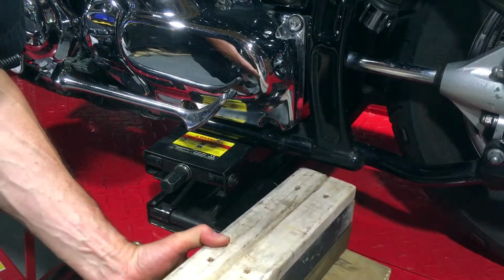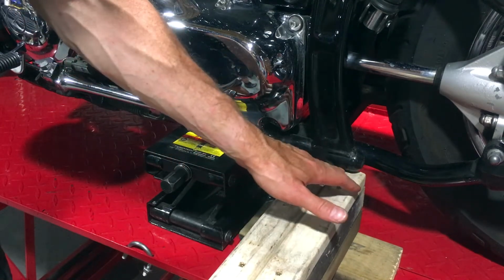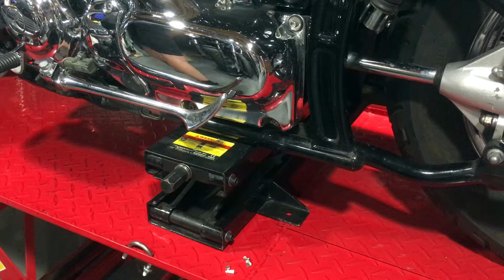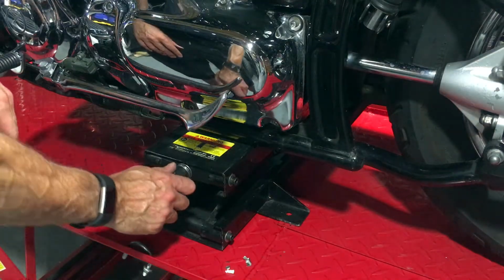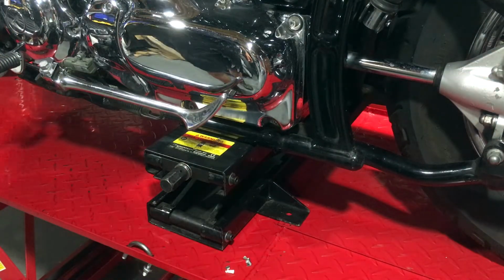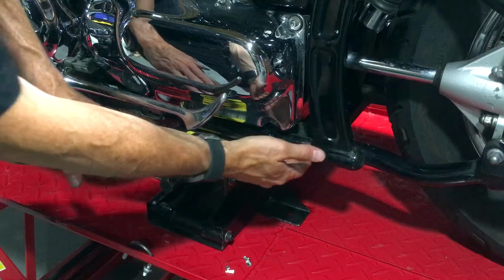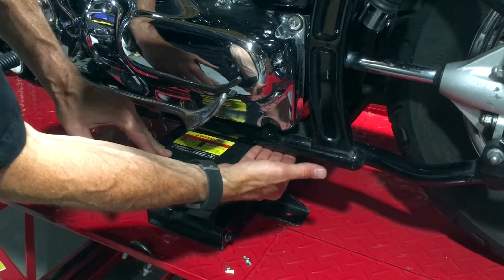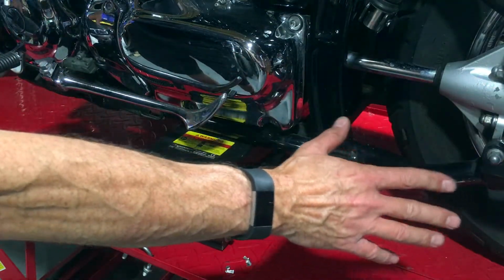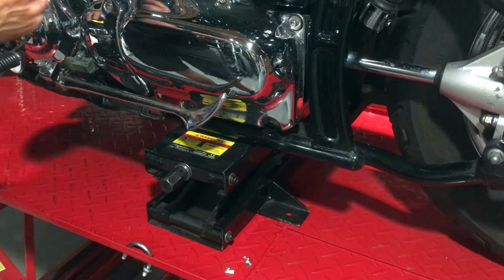Now, this doesn't form a tight fit under these rails. There's a little bit of wobble room, but I can shim it with pieces of plywood so that it does actually sit level. But a table jack does the same job. Again, it's a little bit of an investment, but they are really useful. And you just wind it up. This one's just hand tight because the bike is currently held at the front by the rack. I don't want to lift it because that will change the angle of the bike. I just want it enough tension so that it sits on both this rail, this side, and the other one, so the bike is dead flat on the ground, and with both wheels on the ground, so the bike is completely level. This assumes you're on level ground, of course. Right, and then the oil level will be spot on.